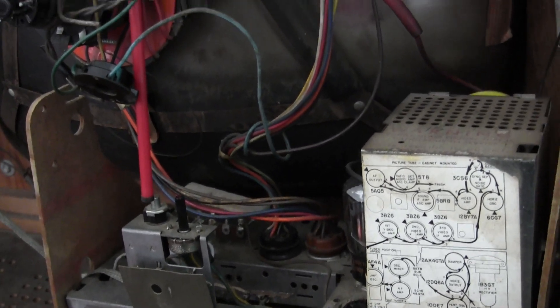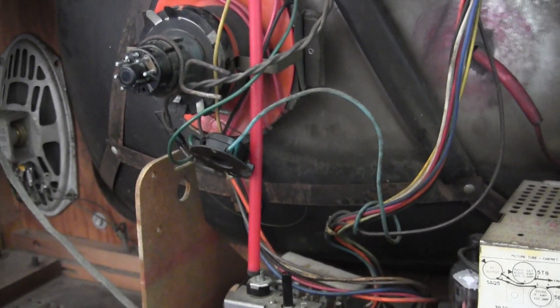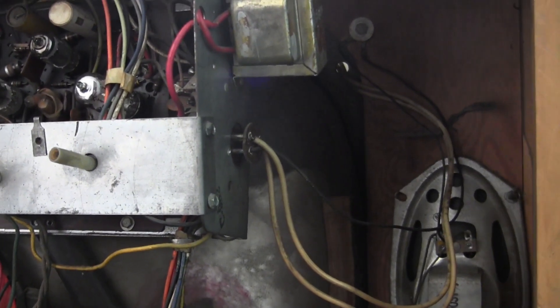Could I try the halo light without the rest of the set? Yeah, if I could trace out the wiring — I'm still not quite sure what the transformer is for it. I should be able to hot-wire right into the bulb to see if it's good and bypass everything else. I suspect the connections are somewhere down or up there. Those two wires — somebody has disconnected it. I was thinking this might be the audio output transformer, but no, that's got to be the halo light transformer. It's a little bell transformer, and if I'm right this would be the high voltage going right to that connector for the halo light. So somebody decided to unplug it. This is the cheap version — it's either on, or if you want it off you pull that plug.